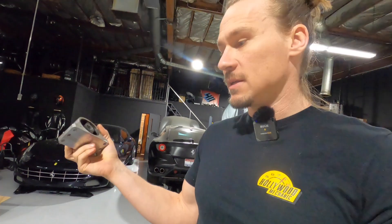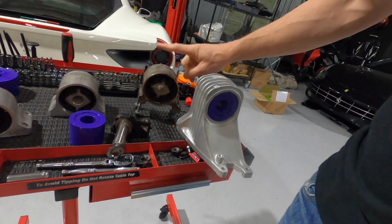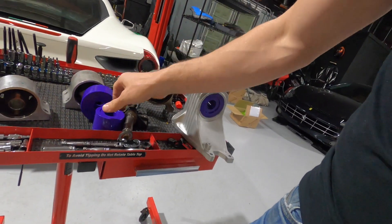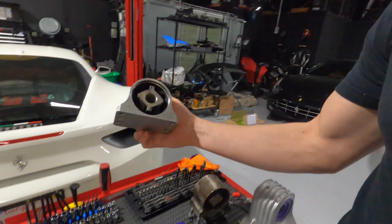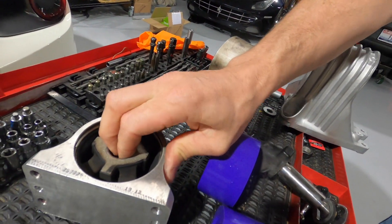The rubber is not only cracking, but it's also very weak — look at the amount of free play in there. It was such a big deal that as they increased power, they've increased the size. They started here, here, and now look how large this one is — this is our largest bushing by far. Compare this size to this size, and even with the FF I can move this by hand, I can twist this and jiggle this around. So imagine what 700 horsepower is doing.